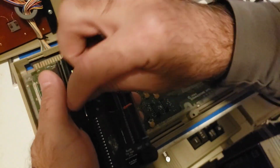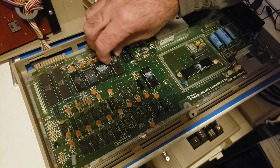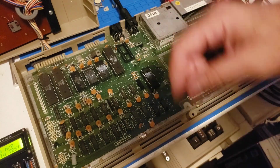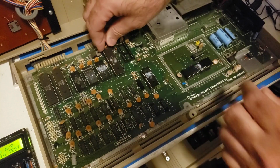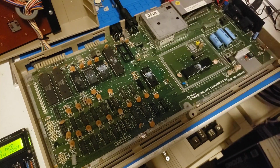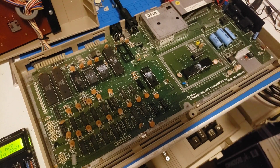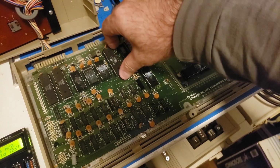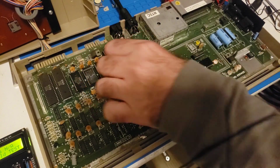All right, so this is a good CPU. So let's put this guy in. Will we get this lucky? I think so. I mean, it's not luck really, honestly. If you get the 0 page fault and you're getting stuck on RAM test 1, which is only part of the memory that it's testing, it's not atypical for it to be the CPU. Making sure I got the pins all in. All right.